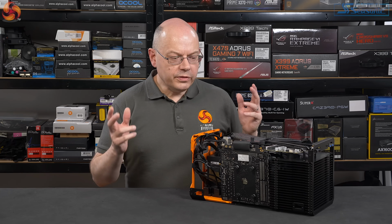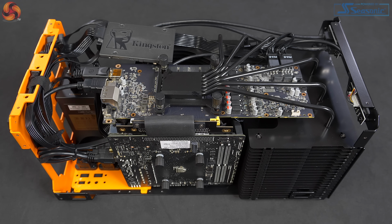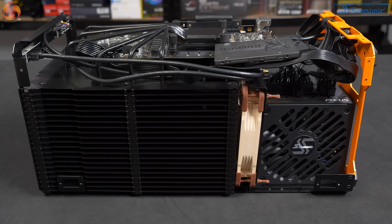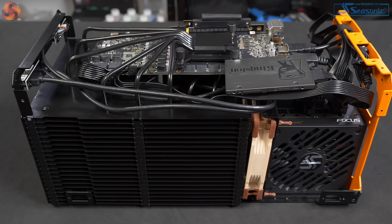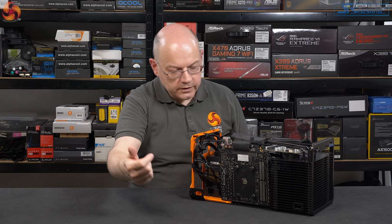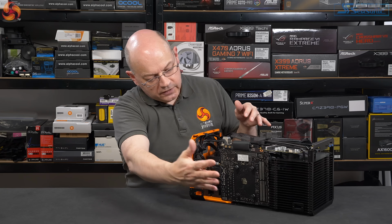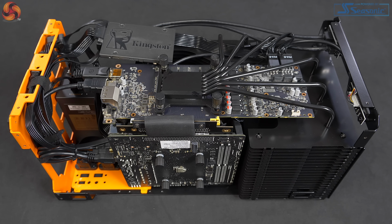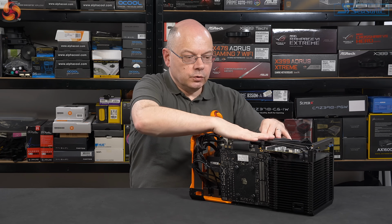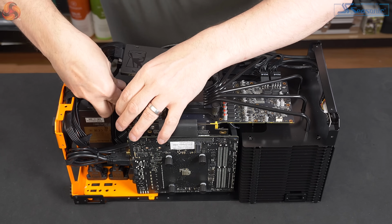Behold, with the first torn down to this stage, you can see there isn't really a chassis. The heatsink is obviously a vast part of the structure and the various other bits attached to it. So we have the heatsink, we have the 6 heat pipes going to this cold plate, and the 6 heat pipes going to the other cold plate, which is on the CPU, and then the motherboard CPU assembly attaches on that face, and we have here the graphics card on this face, which I can see is installed from the underside. To remove the graphics card, let's disconnect these cables